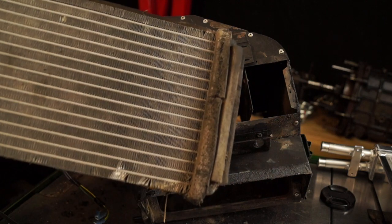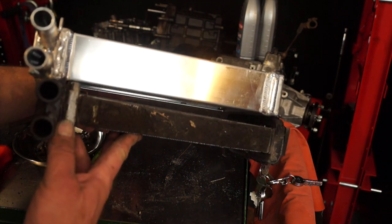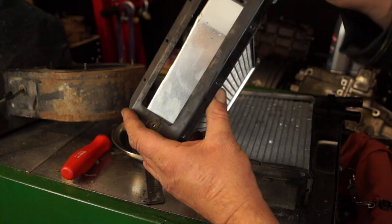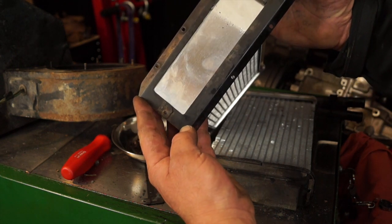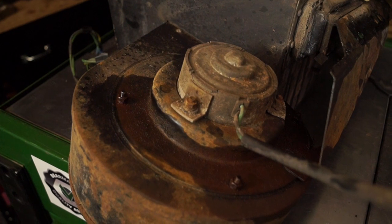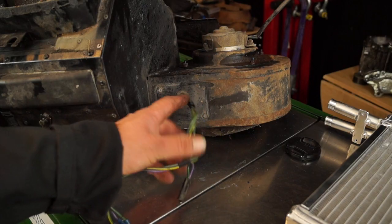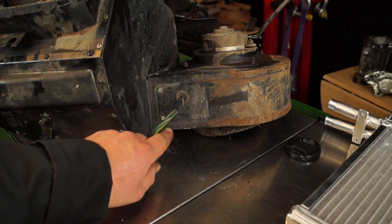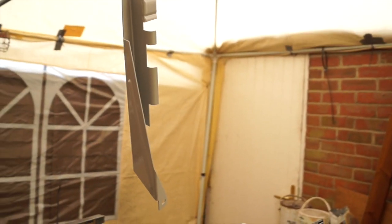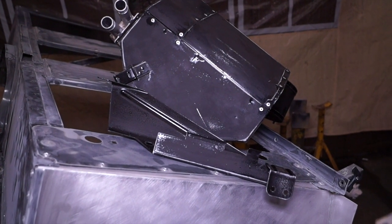The box is a bit raggedy and there's a fair bit of work to do, even though the heater matrix itself isn't in bad condition and isn't leaking. The new heater matrix is a lot larger with much better heat capacity. The retaining plate apertures are too small so we'll have to cut them bigger. I'm not happy with the condition — it's rusty — so we need to do some rectification work. I've taken out the resistor piece, which is held by four rivets, then stripped, rust-treated, and primed the heater box.